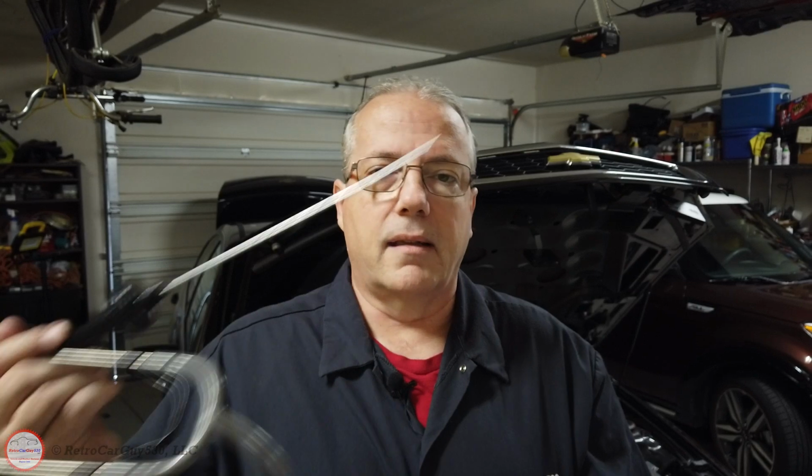It's electrically charging just fine, but I noticed the other week that I was listening for noises, checking out the radiator cooling system, making sure it wasn't leaking after that repair of my radiator that I did in the cooling system refresh video. And I noticed a random metallic tapping noise, and no, it wasn't lifters. But I used my stethoscope to narrow it down. I went through the idler pulleys and tensioner pulleys and got it down to the alternator. It was right in the alternator itself.